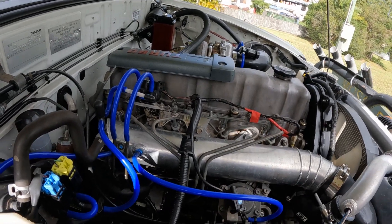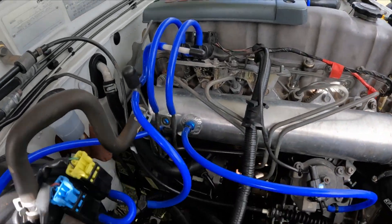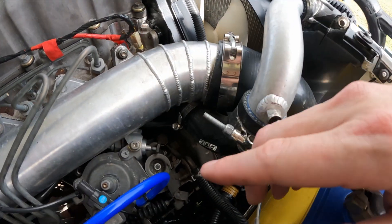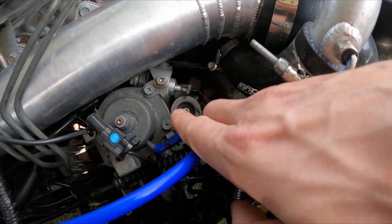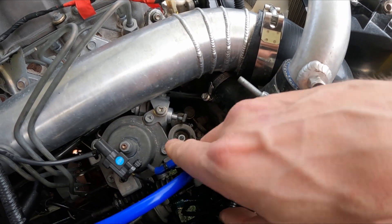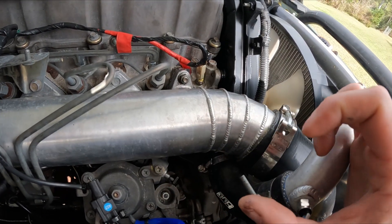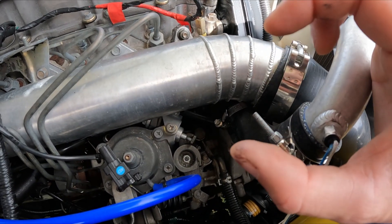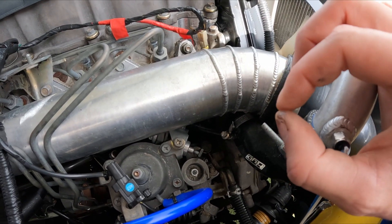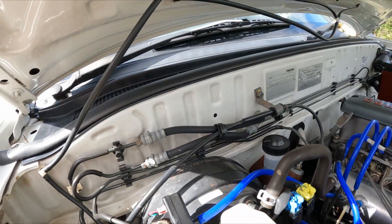On your stock setup you're not going to have extra outlets on your plenum. You'll likely have a nipple somewhere up here that feeds into your fuel diaphragm. To add a boost T, you'll need a three-way adapter — one port goes to the plenum nipple, one goes to the fuel diaphragm, and the third comes out to your boost gauge.